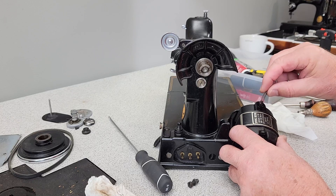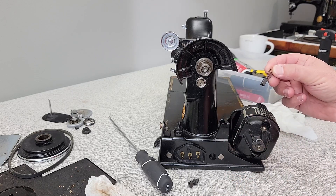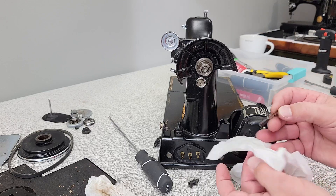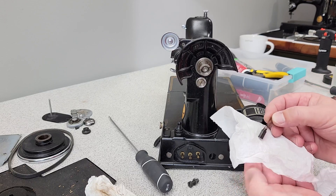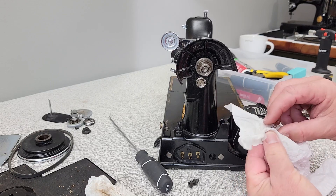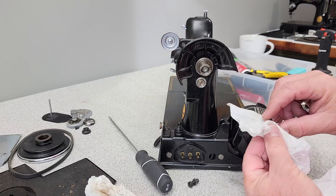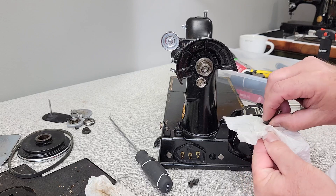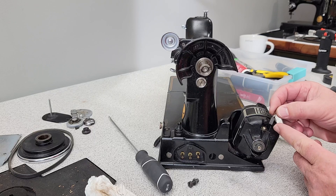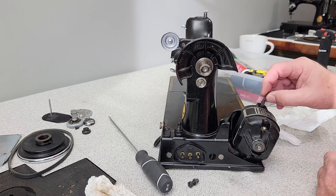Make sure that's getting clean. Pull out your brush. This one has more than 50% of the brush left, which gives me an idea of how much the machine was used. I'll just take a clean paper towel and wipe off any of the carbon powder that's on there from the brush wearing over time.